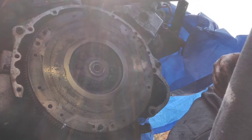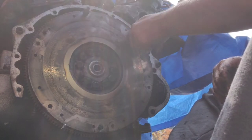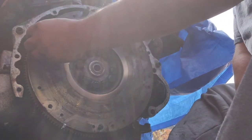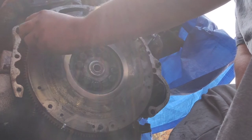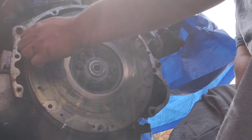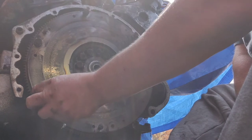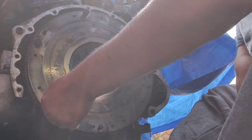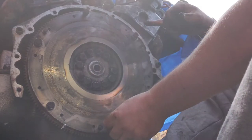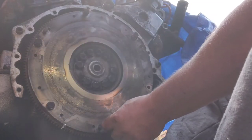Now this clutch and that, this is all custom made by Vince, because obviously the Jag V12 comes with an automatic gearbox. So it comes with a little tiny light flywheel and a great big torque converter. So what we did, if I remember rightly, when I ordered my kit, is you send him the flywheel and he takes off that ring gear with the teeth, takes this piece off. He made up this on his lathe